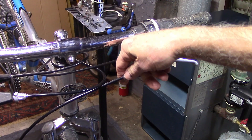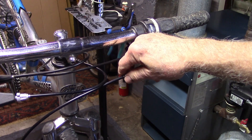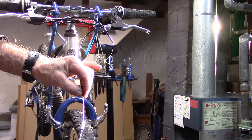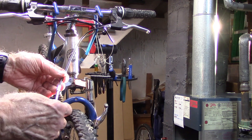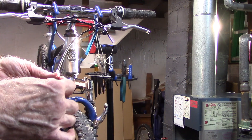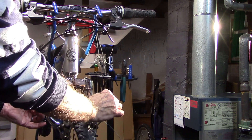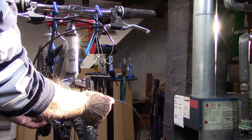If the brake pads are too tight, we can turn the barrel adjuster clockwise so they don't rub, or turn it out if we need to get the pads a little closer. Interestingly, we don't need a ferrule at the end where it enters the noodle — the metal end of the noodle acts as a ferrule itself and secures the housing so it doesn't bend. We'll put on the rubber dust cover and insert that into our housing, then insert the other end of the cable through the small hole in the brake arm.